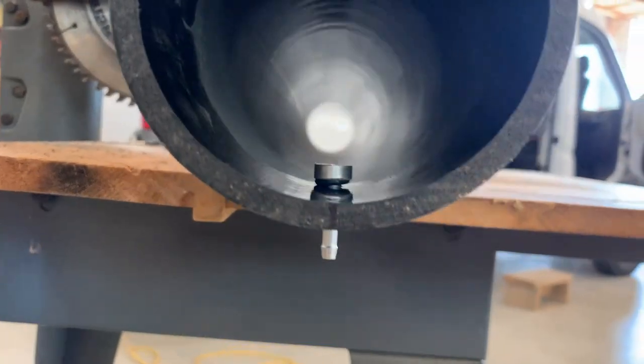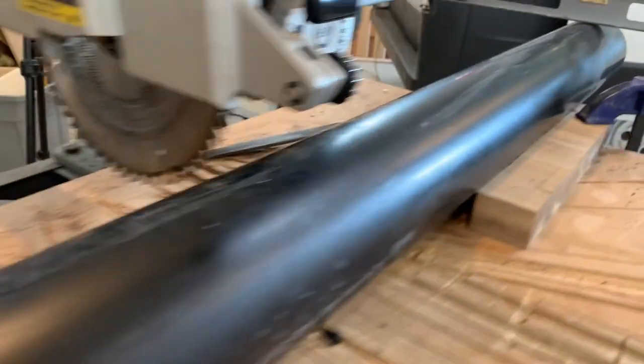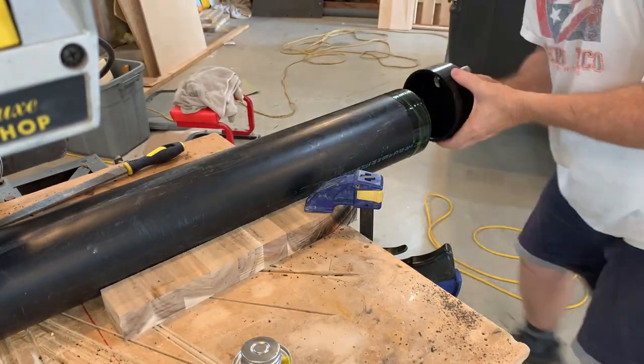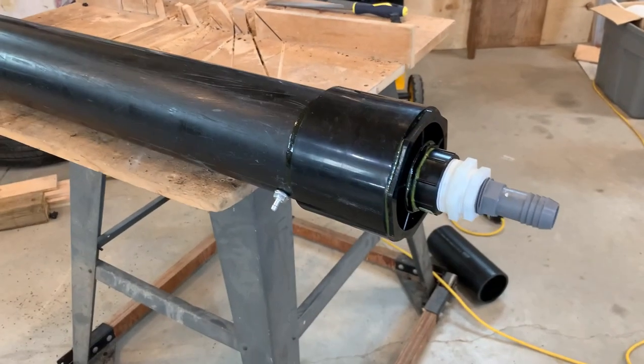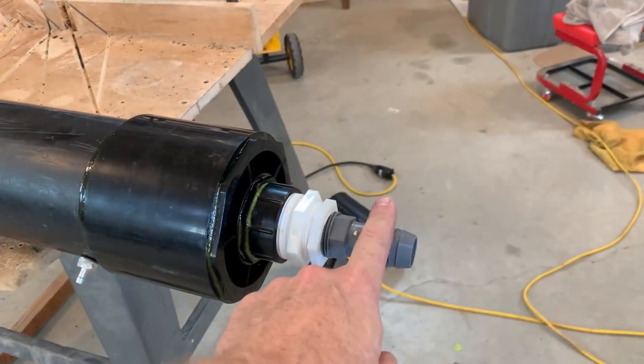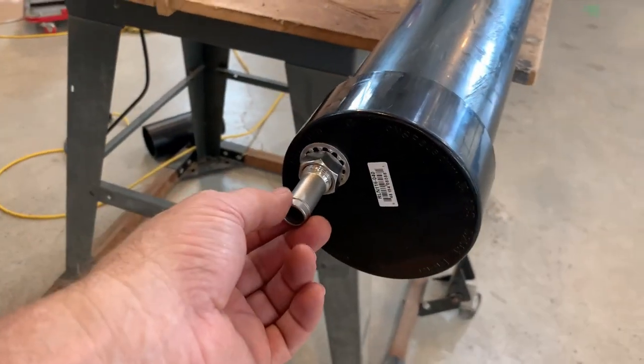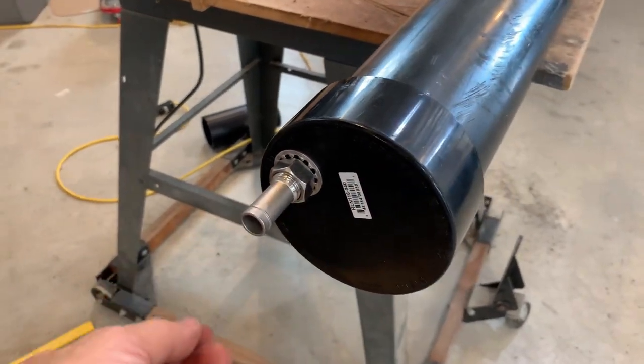I am very carefully marking the vent right now for the fuel. This is the fuel intake that'll go to the pump. I'm making a mark on the pipe to make sure the vent is at the highest spot, with the two marks lined up. Here is the finished fuel tank: 50 inches long, four-inch inside diameter. This end is the one-inch filler. This is the fuel pickup that came with the Chinese diesel heater — a one-eighth-inch fuel pickup. Down at the other end, at the highest point of the tank, is a five-eighths adapter — that's the vent. I'll have the parts for all of these in the description.